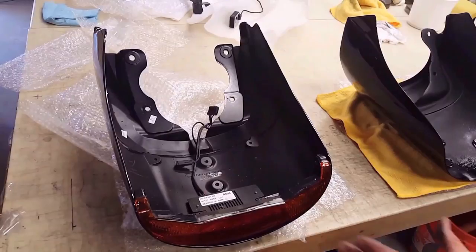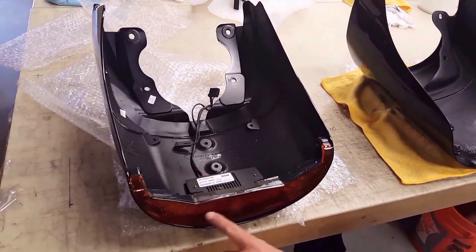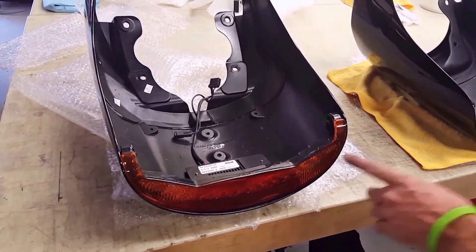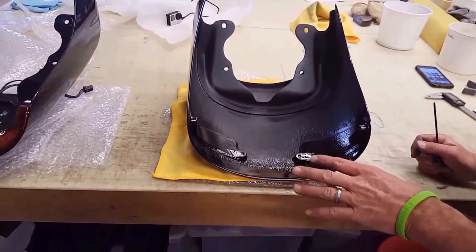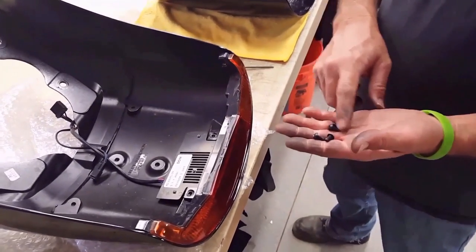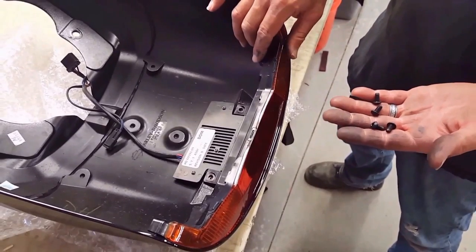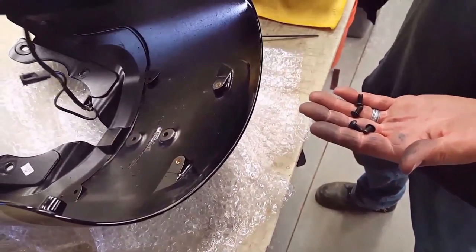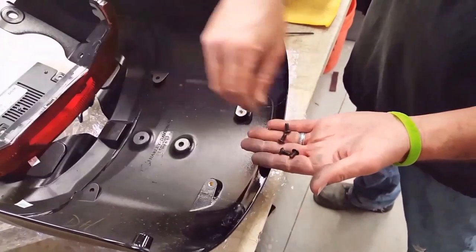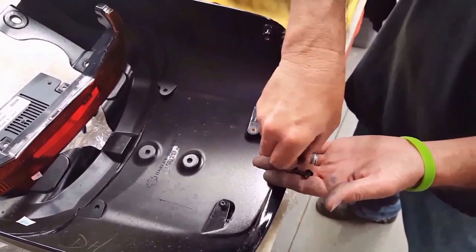Okay, here we have the OEM rear fender for the muscle, and we're gonna remove the stock taillight system out and reinstall it into the Cafe Racer composite fender. We have now removed the metric screws from the OEM fender taillight section. We are not using these screws. Put these screws right back into the fender and put your fender wherever you are gonna put it.